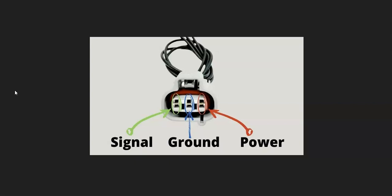There can be differences — older Hondas often had two wires, some newer ones can have four, and three wires is fairly common. Always get schematics for your engine. Basically, one wire is a ground, one wire has power going to it when the key is in the on position, and one wire is a signal wire that goes back to the onboard computer. Every single time there's a piece of metal directly in front of the sensor, it sends a pulse back to the onboard computer.